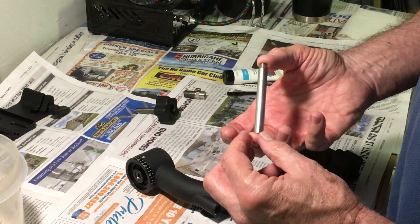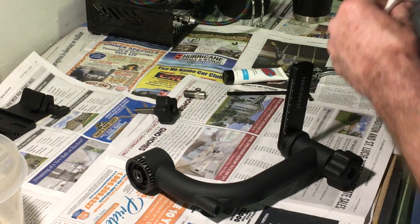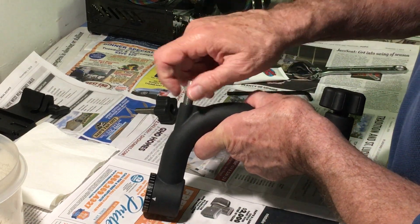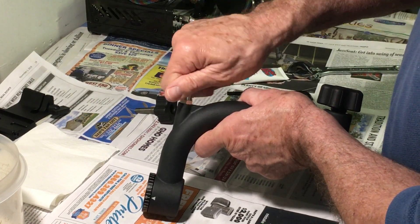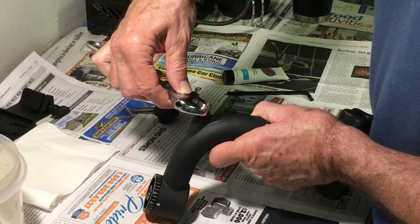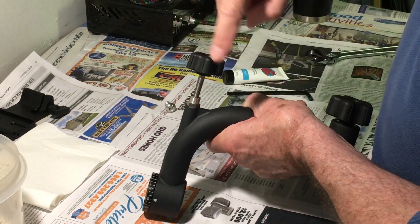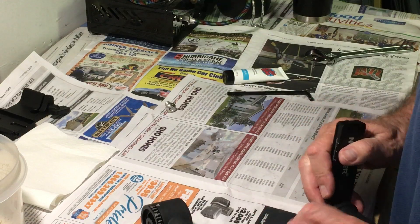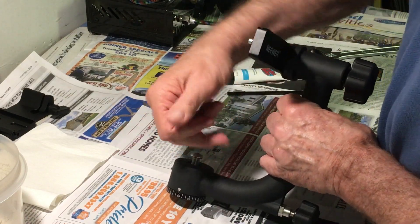Put that back in place, then do the reverse of what you did to take it apart. Put a thin coating on the ram and put that back in there. Grab the threaded sleeve and put that back on — it's really easy, not a whole lot of parts to this, and what you're doing is going to make a huge difference in performance. Crescent wrench back on, just snug — that's all. Put this back on and snug it all the way up tight. The reason I snugged it up is so I can put this screw back in without that base plate turning.